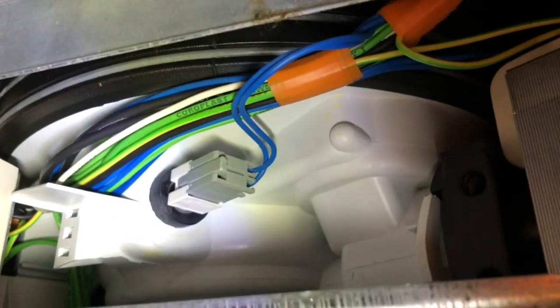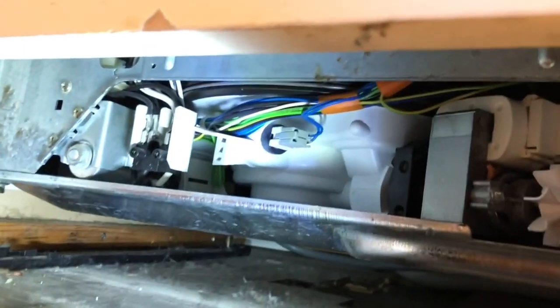Or also could be this sensor, which you can get from Miele USA. Give them your model number and tell them you need the temperature sensor, and they can send it to you. And again, really easy to put in. You just take off the bottom panel, called the kick panel or toe panel, and then you take off a little metal panel in front, and then right there is your temperature sensor. You can just pull it out. It's good to get the water out of that little sump area first, because otherwise water will pour into the pan. All right, thanks so much.